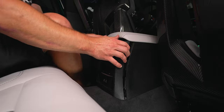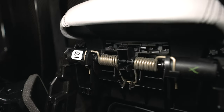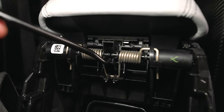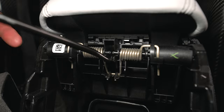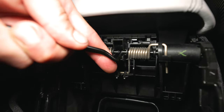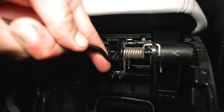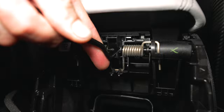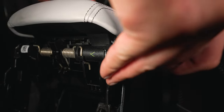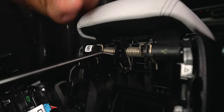Fold that down like that, and then this is going to pull out just like that. Next, you want to start to release the pins. If you look in here, there are two pins — the pins go from out and they go in, which is why we needed to move the seats out of the way. I like to take one of these big pick tools and start to move it over, then from the side just pop it out.